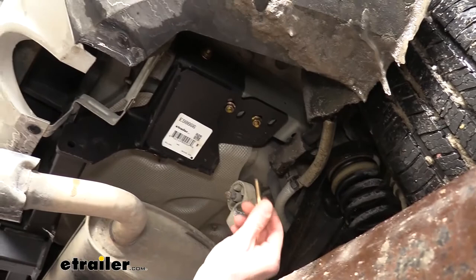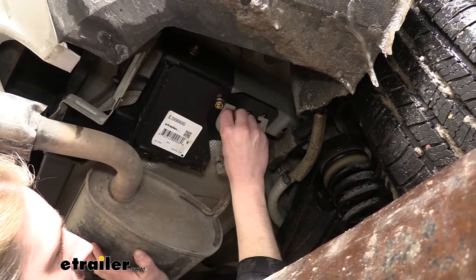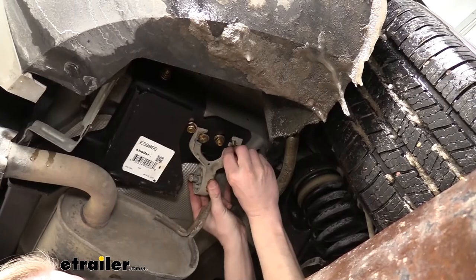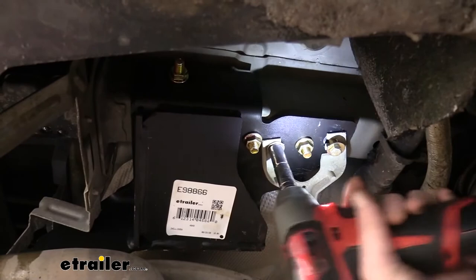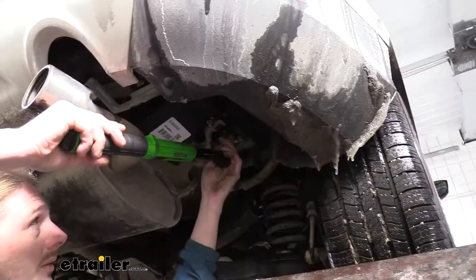With all carriage bolts loosely installed, we can put our muffler back into position. You're going to use the newer hex head bolts that come in your kit — place a flat washer on each one and reinstall them in the same location we removed them from. We just have longer bolts now to accommodate the hitch. We left the carriage bolts loose because you may need to make subtle adjustments to line the hardware back up. We can now go back and tighten down our hardware using an 11/16-inch socket for the larger bolts and a half-inch for the smaller hardware, then torque all hardware to the specifications found in the instructions.